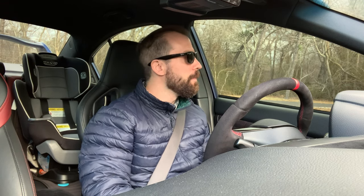I do this around eight to ten times in a row. So I'll go 50-60, slam the brakes down to about 10, get back up to speed, over and over — about eight to ten times. It's repetitive. If you get motion sickness in a car, just be ready, because this does make you a little queasy if your stomach's uneasy. You can take breaks here and there, but I do suggest doing this continuously so the rotors and pads get a proper heat cycle. If you let the rotors cool down in between all the braking, they just won't bed in as well as they could.